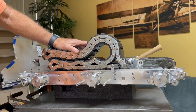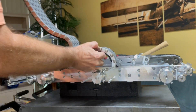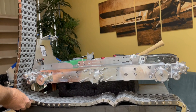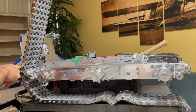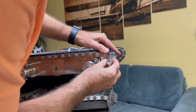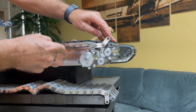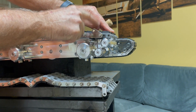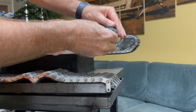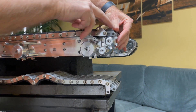Now I'm going to put the new track on. What I need to do is take the track and feed it through the back, putting the track engagement onto the sprocket. Then I want it to come all the way forward so it can engage on the front sprocket as well. Now I'm going to take these clips — the little links — and bring them up from the top and set them in position right there. If they're hanging down, it's going to be very difficult to maneuver them later, so put them up on top, both sides.